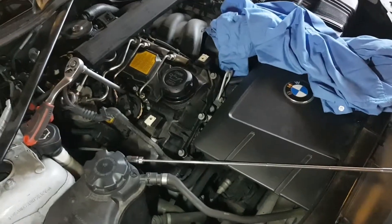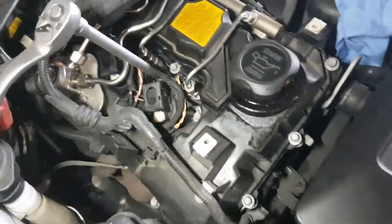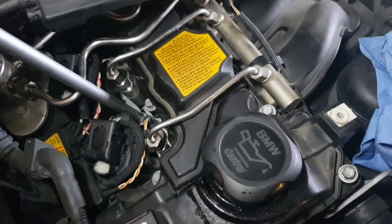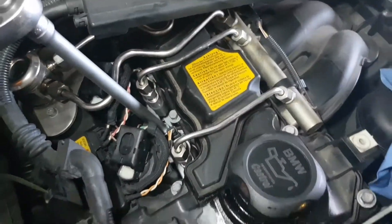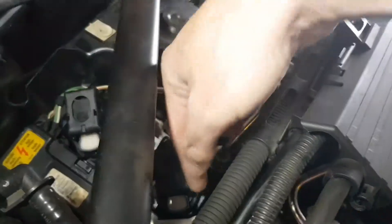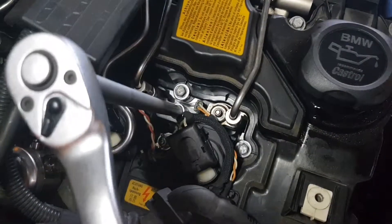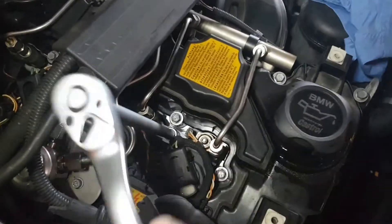I'm still in the same spot except I've let the engine sit for quite a long time to ensure it's cold. I've cracked — just with a spanner — this nut here on injector two and this nut here on injector three, so they're loose. Then I'm going for the bracket down here — the little clamp bracket that holds the injectors down. It's an 11mm nut on that.